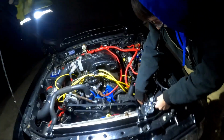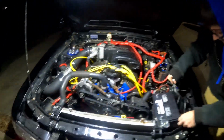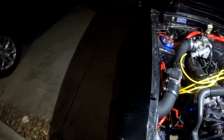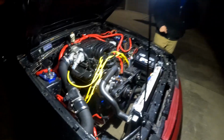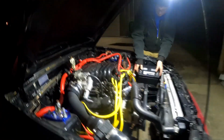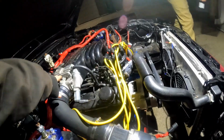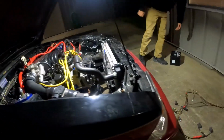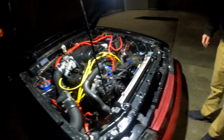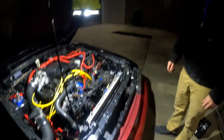We'll get this thing ordered and thrown in there. Like I said, plug and play from then on. It should be smooth sailing, just a little bit of fine tuning. It's got a miss somewhere, but I might have to readjust the distributor. I kind of just dropped it in there from where the last one was sitting. Like I said, we've got some fine tuning still to do. Coolant, vacuum lines need to be perfected, and probably tuck this new harness. Whatever goes on, it's gonna be pretty sick. This thing's gonna look awesome by summer.